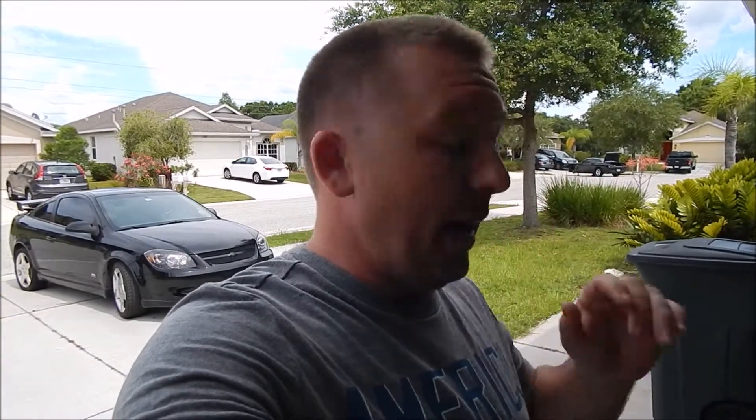On this particular hood, when I got it, there were already hood pins put in place, which had two big massive holes and eight smaller holes that I had to fill in with bondo glass and bondo. I wet sanded all that and filled it in.